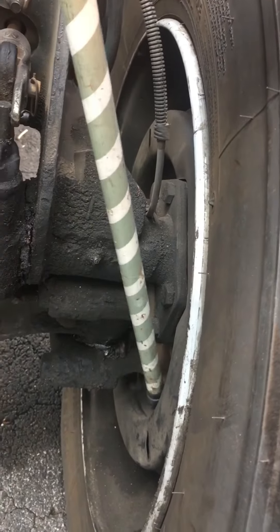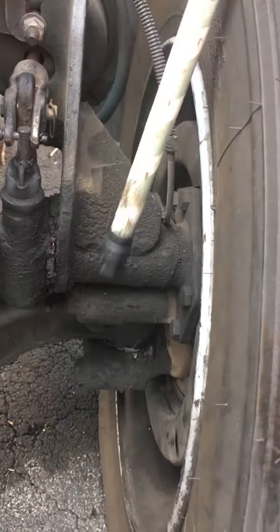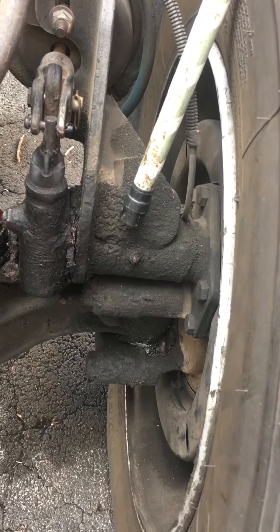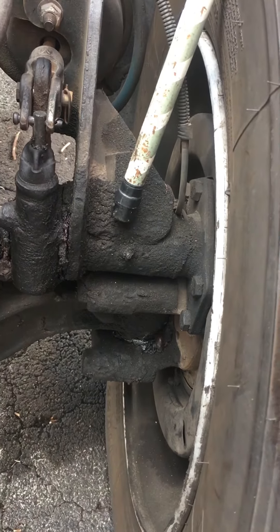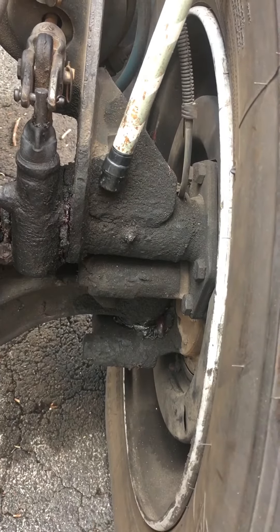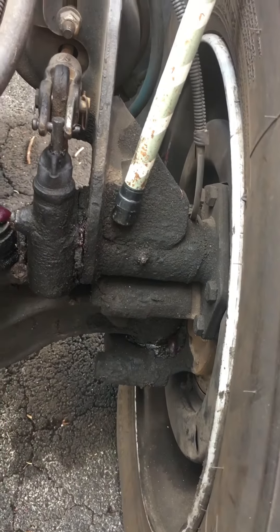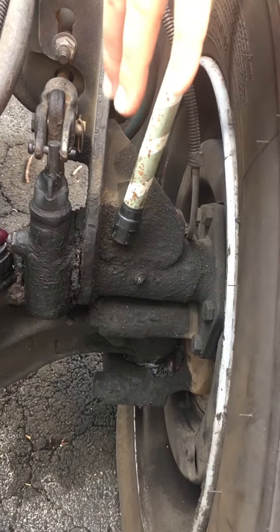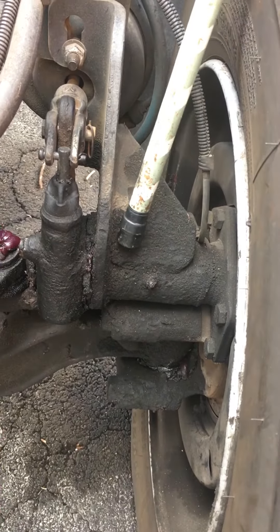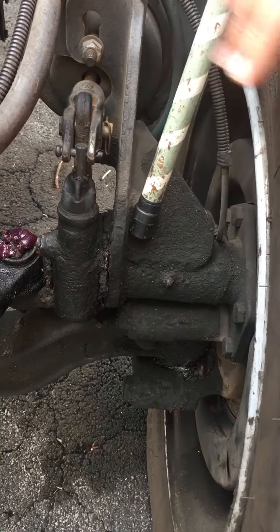There's a dust cover over the brakes, but we'll cover it anyway since they're testing you and not the truck. Brake pads: not missing, not cracked, not damaged, and not worn dangerously thin. Looking inside the brake drum: check for contaminants such as debris, oil, and grease. Check the condition of the drum itself — properly mounted and secure, not cracked, broken, or damaged, checking for holes and dents.